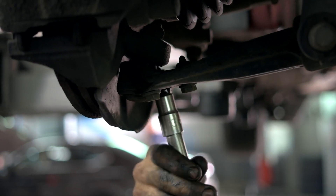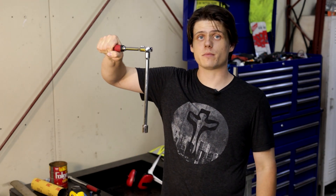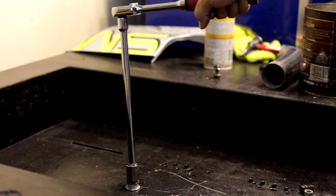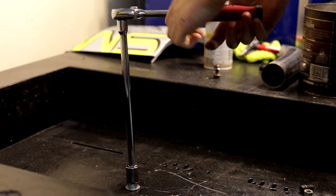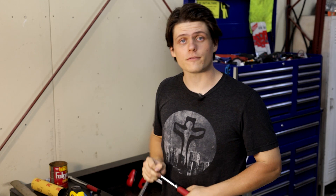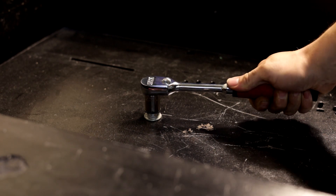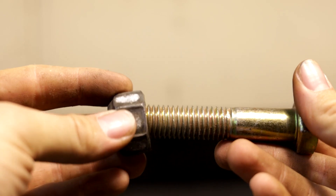It's also important to keep in mind that torque acts on the socket extensions as well. When you have a force being applied trying to rotate the bolt, it is also trying to bend the bolt and pull the socket off of the head. If you don't have the space to get your hand up onto the head of the ratchet, use the shortest extension possible to loosen the bolt — otherwise you're putting a bending load on the bolt and it might damage or even break the fastener.